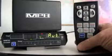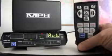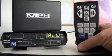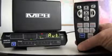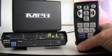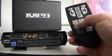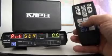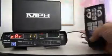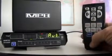For example, let's say we use this radar on a Crown Vic. So we go in and set the code at whatever the preset is. You look in your manual, all of those settings are in there. Say we use that for a year on the Crown Vic, then we take this same radar and move it to a Chevrolet Impala. Then we go in here in the second function menu, like I showed you here, go past those, go on into the car, and you set it for Chevrolet. And those codes are of course in your manual.